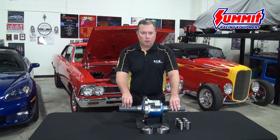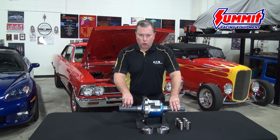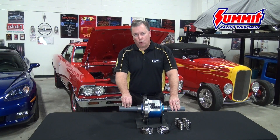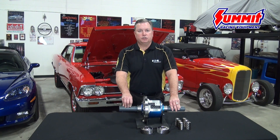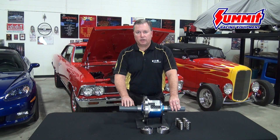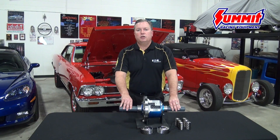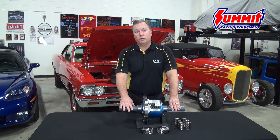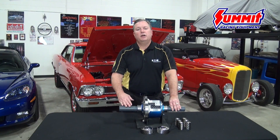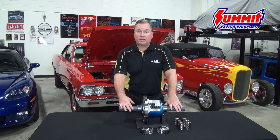As the bias value goes up, what you're going to do is move towards a condition where the torques on the axle shafts will equalize and get both tires doing as much work as possible. In the case of an on-road application such as a street rod, street-to-strip, or drag racing, as you aggressively accelerate off the starting line, you're going to temporarily create very high gear separation forces which forces both wheels to drive in unison and propel the car forward as efficiently as possible.